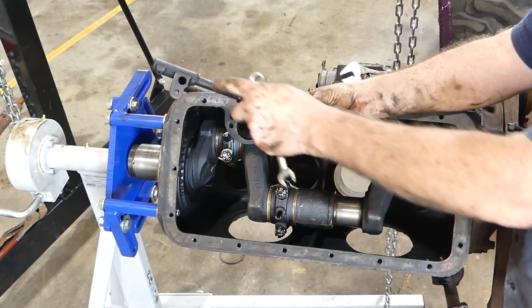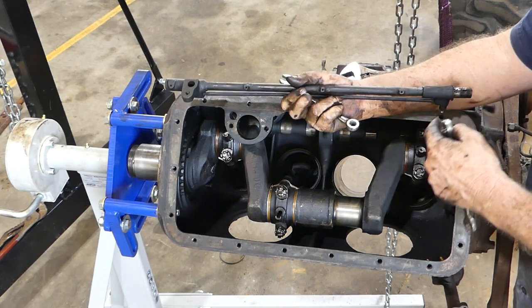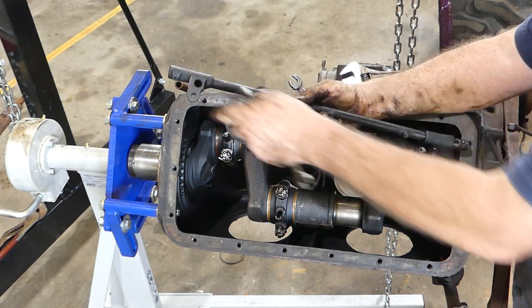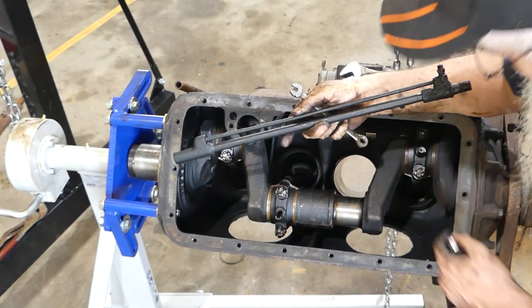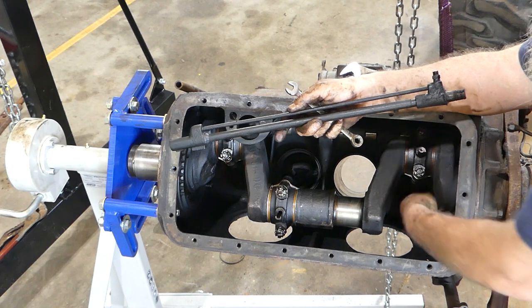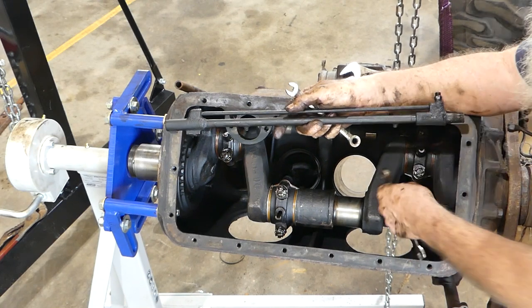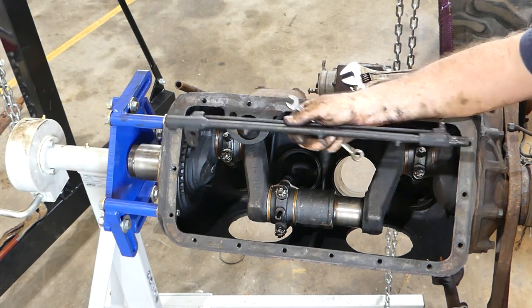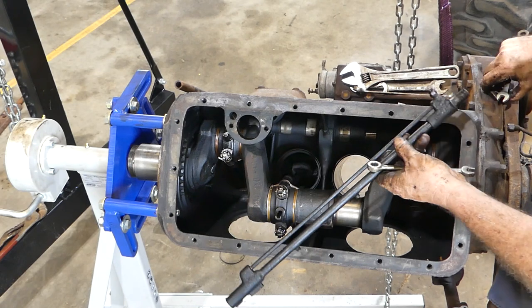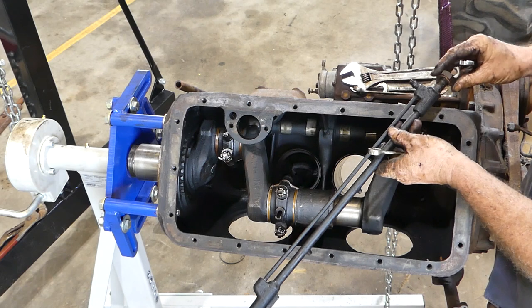That's the oil manifold. Oil comes in here, sprays out into those little places, little squirters. Oh, there's the other hole. And then it comes back and goes up here. Yep, I'll tell you where that one goes when I know. There you go. Another bit out. We'll put the washer from the nut back on here. Copper washers, so we can probably just anneal the copper washers and get it back on.